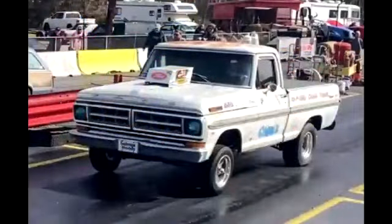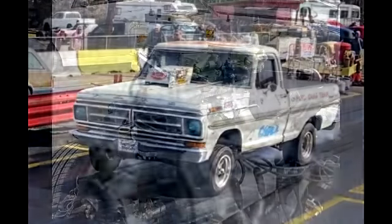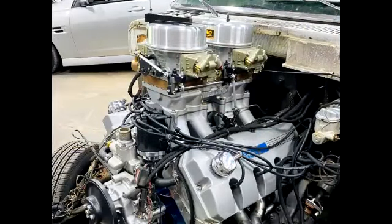This whole idea was for Casper, which is Andy Wood's, I think it's a '71 or '72 Ford F-150 that he runs a C4 in. It's got a big Hemi, a Ford Hemi, in it, and he's limited to where he can drive it because he's got 410 gears and those tiny tires. Well, now that we have an overdrive transmission with lockup, he's going to be able to have, like I do in Mr. Haney, a ton of gear, and still be able to go 60 miles an hour at around 2,000 to 2,100 RPMs. So you have the best of both worlds. That's why I developed this valve body.